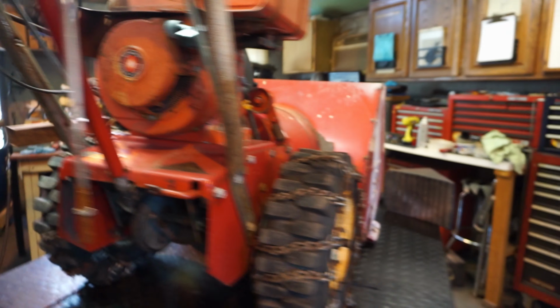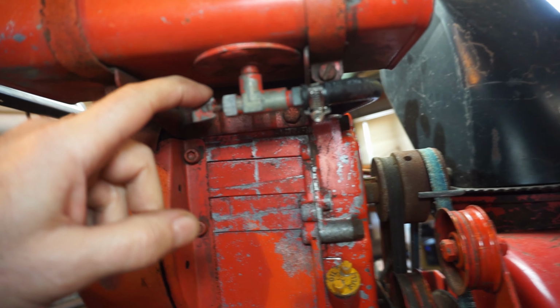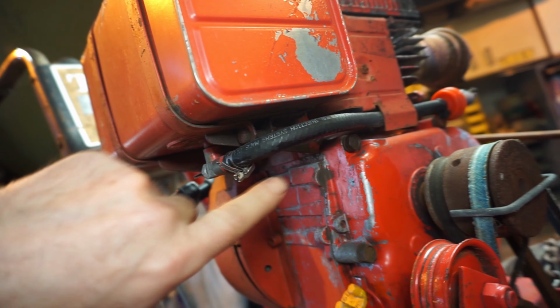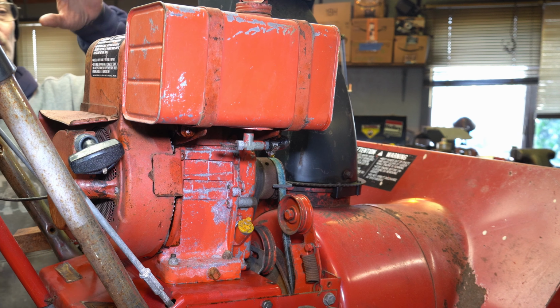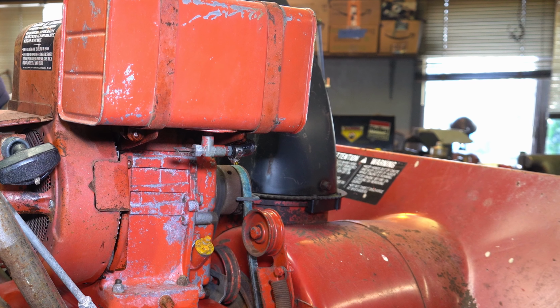We'll also have to get the gas tank off, because we want to clean that. See, here's the petcock I spoke of earlier. Let me get some lubricant on all of that, and let me pull that off, and I'll be back over here too for these straps. I had to go slow on these upper bolts. So a lot of lube, and then go a little bit, back up, go a little bit, back up, right?